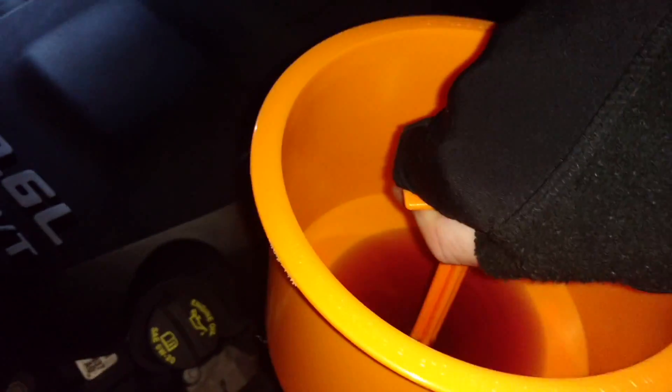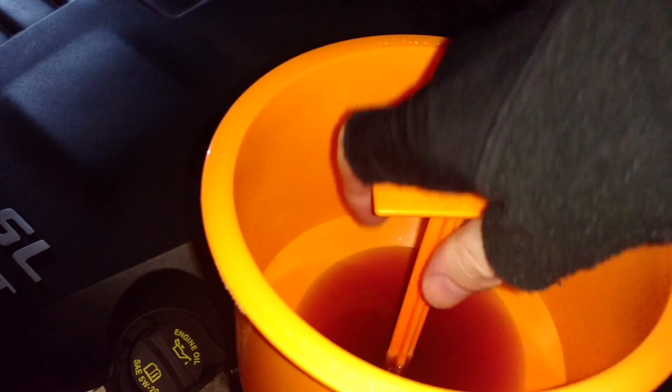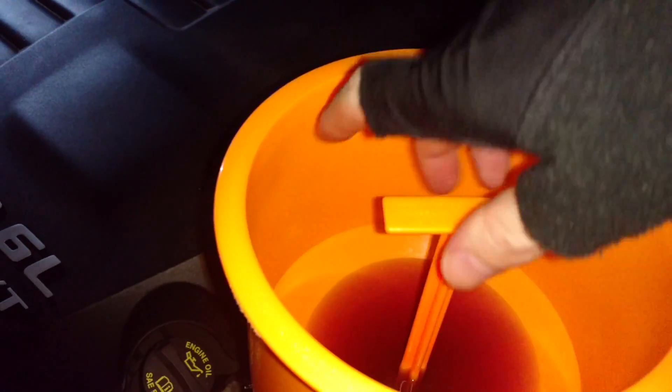When you think you've got all the air out, you'll notice that the level will drop a little bit too — that's a good indication that a good amount of air came out. Now you want to get a little plunger, so let's go on a little walk here, and then just engage that so we can transfer this to the coolant bottle and put this back in.